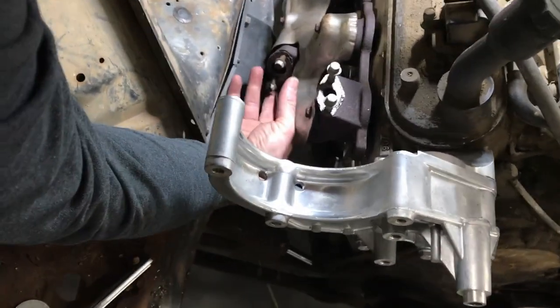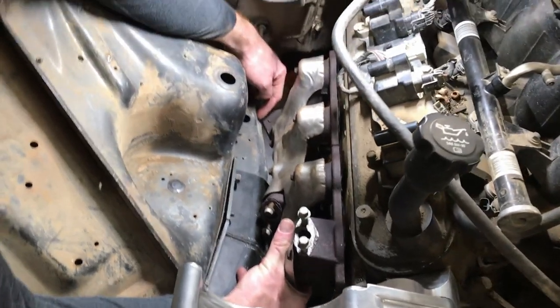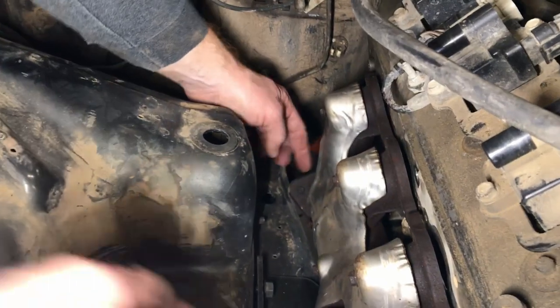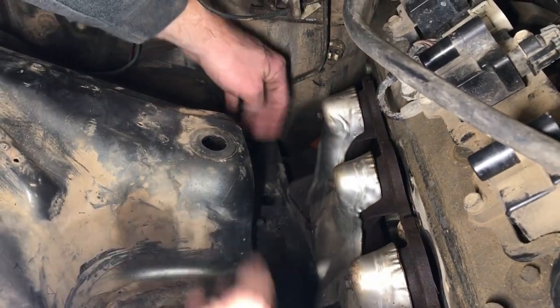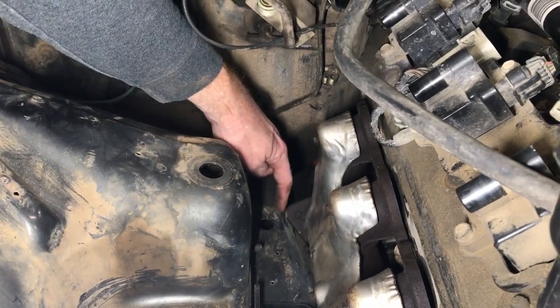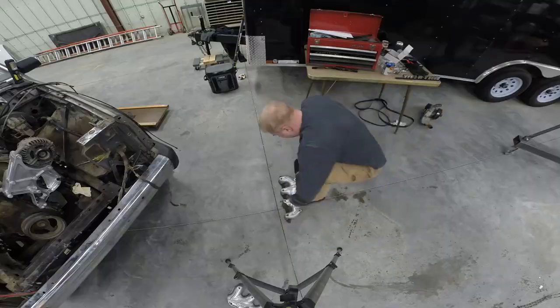The heat shield's easily bent if that's the problem. This is the problem there. It's hitting the frame. And that's where other people have had to clearance their frame. A sledgehammer will fix that. Yeah, it needs to tip this way. You can see it right there, and you can see it's gapped out here. Hey, we should mark that with chalk or something. Well, that's what I was just saying. Before we pull it out, we need to mark it with Sharpies. Okay.